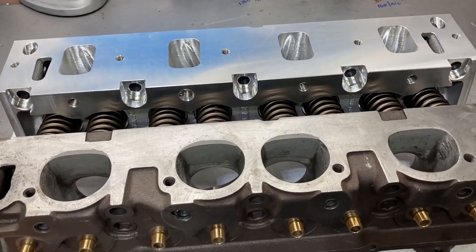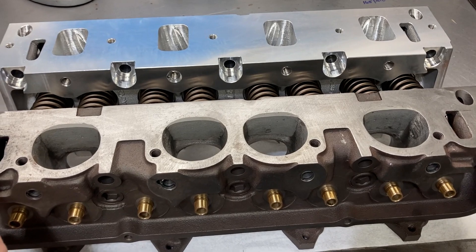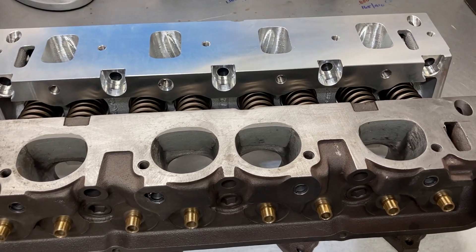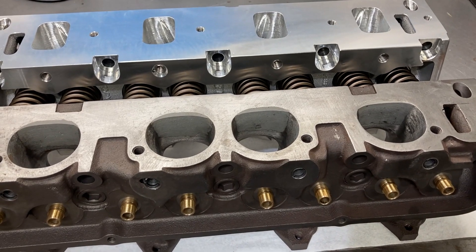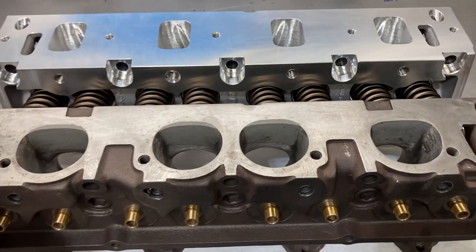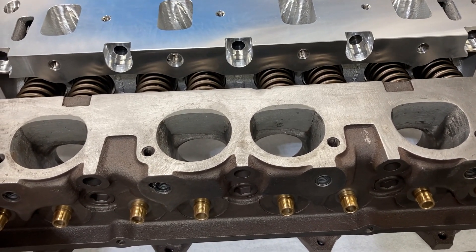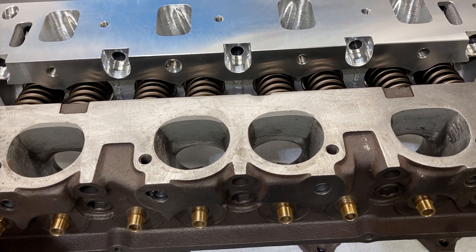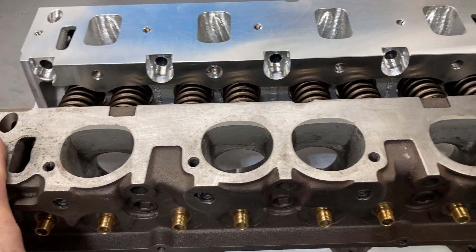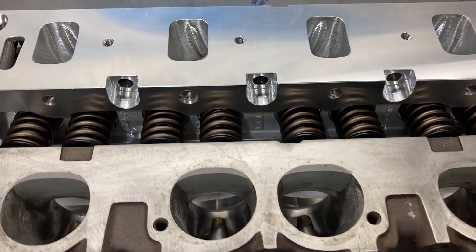This is Brent with Likens Motorsports. This week we are finally getting to take a look at some tunnel port heads for my customer's 465 tunnel port build. I just got the heads back from being ported and we did a few other tricks as well — modern upgrades, I would call it. The tunnel port head is from 1967; they were not available in any production vehicle. They were available over-the-counter from Ford and were used in NASCAR and other high-performance racing venues, meant for very high performance and racing applications.